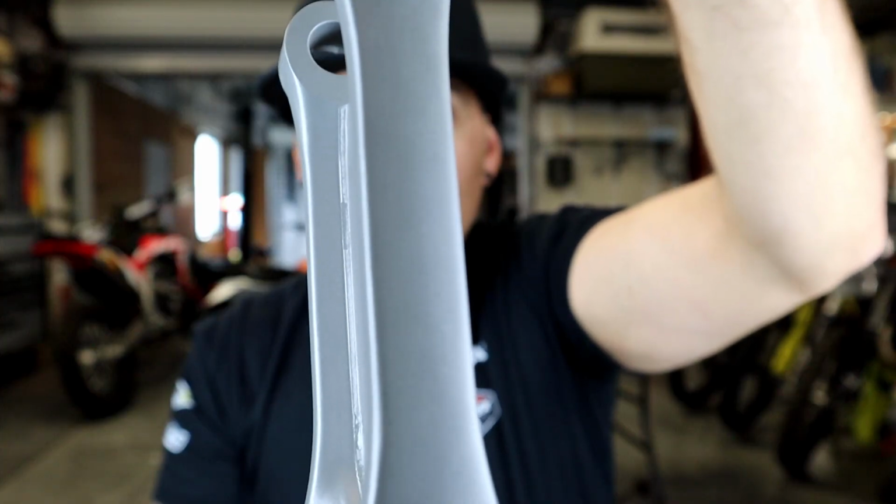So I went ahead and finished deflashing the linkage. It came out great as well. Went ahead and blasted it, prepped it with the acetone, shot it with the stainless steel gray. It's also matched to the frame. And as you can see, no more casting flash.